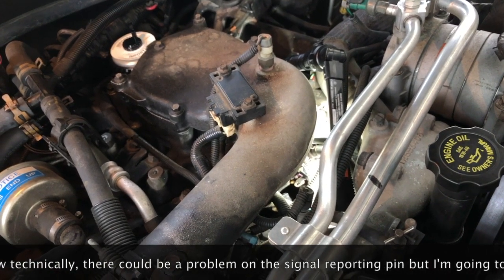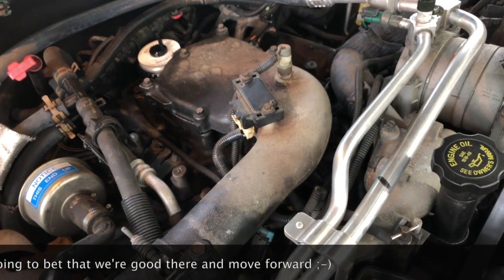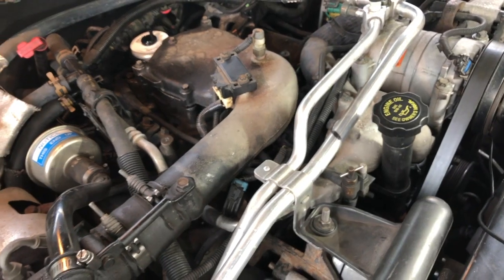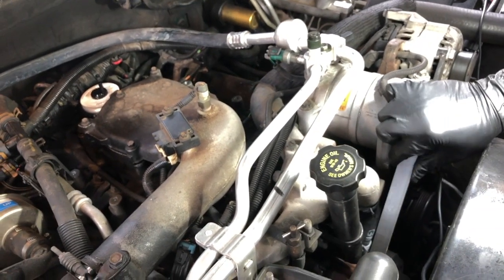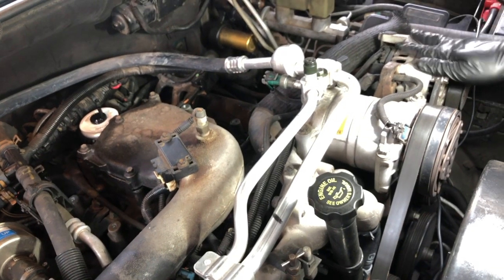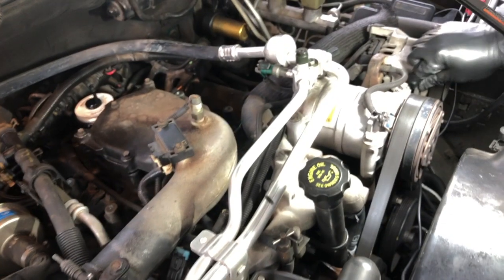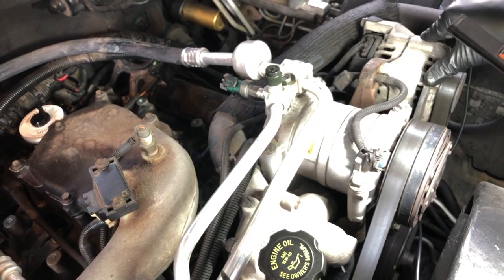So I guess we'll go ahead and proceed with the job of actually removing this guy. It's not that bad, I guess, in the grand scheme of things. What I'm going to have to do on this truck, and in all trucks, is take the serpentine belt off. I'm going to have to pull this alternator because this is a double alternator vehicle. There's one here and there's one there. We're going to get this one out of the way. We're going to pull off this idler pulley plate. What we're really after is the power steering pump.